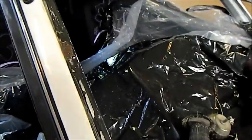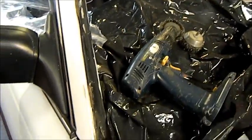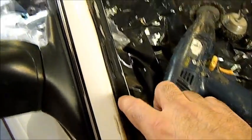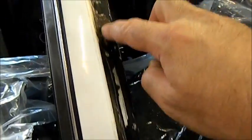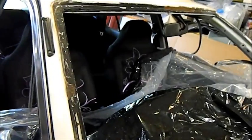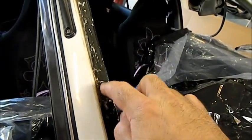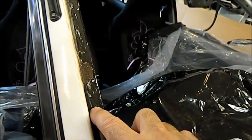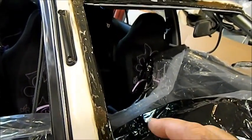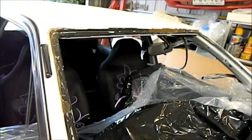This is my daughter's car. I had the windscreen removed and there's bits of rust here. This is quite common on these — it's a Holden Nova, just an AE92 Corolla. None of it's gone through, it's all surface rust. The best thing to do, according to the windscreen guy, is POR-15. Two coats of POR-15 — we'll remove the urethane around that, apply two coats, and the urethane primer they use will adhere to that really well. Then we can have a new screen put in in a couple of days.